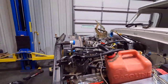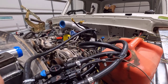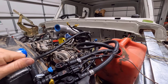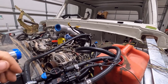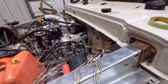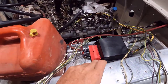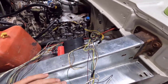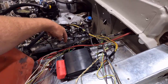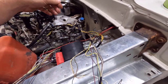I've got my fuel system all hooked up here — this is obviously not how it's going to be; we wouldn't have much range with a two-gallon fuel tank, but it's just up here to get the truck running. I have my battery junction box right here — the one I wired in. I still have to shorten all these wires; they go to these plugs here and I'm going to shorten the pins and route them up here, then once I get all that routed, I'm going to wire loom everything so it's all nice and neat.